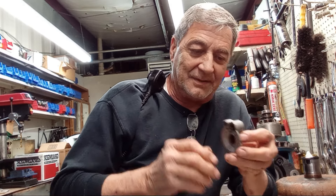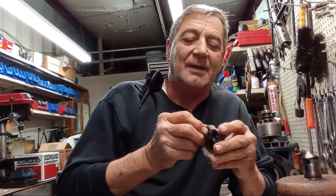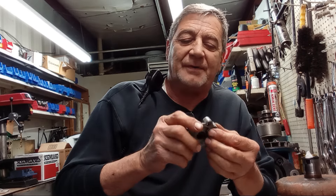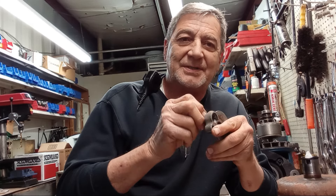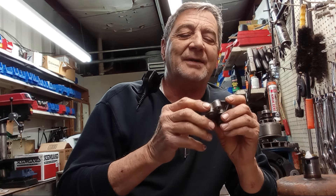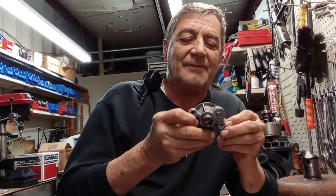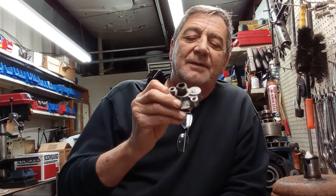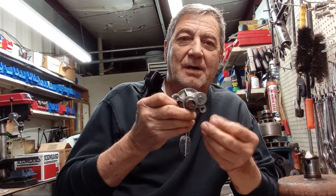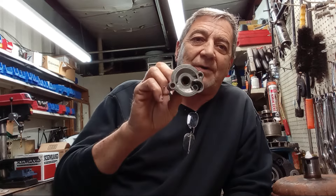That's a pipe thread tap. Then take a plug and screw it in there — get it pretty tight, but don't stress it or crack anything. Even if it was to fall out, it's up against the engine block so it's not going anywhere, but you don't want it falling out. I wouldn't use Loctite because as it dries it gets a little crusty and you definitely don't want that being sent through your motor. If you don't feel comfortable blocking yours off yourself, you can buy one — I think Moroso sells one that already has the bypass blocked off built into it. Or you can just take yours and tap it out and screw the plug in — it's pretty simple to do.